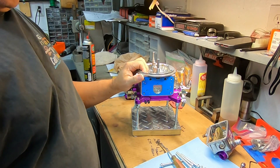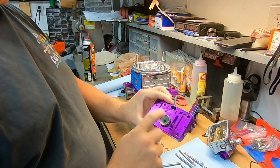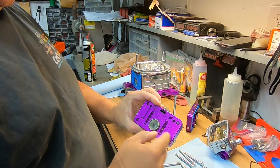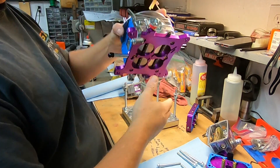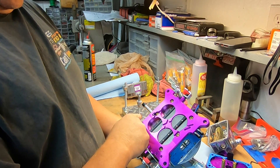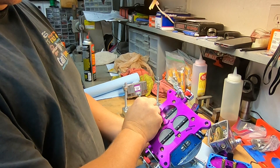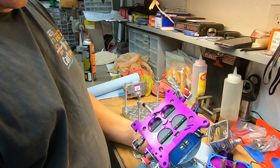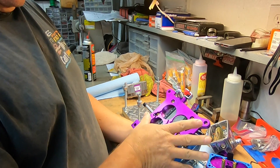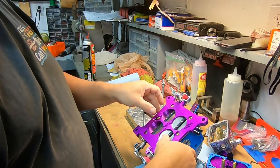The bowl is really stuck on there — got the rear one off as well. The meter plate actually has a plug in it. A little more information on the base plate and what's different between mine and this one: it has provisions for vacuum ports up front as well as in the rear. Mine does not have that — I have no vacuum ports on my base plate.